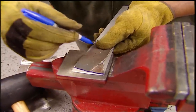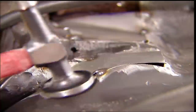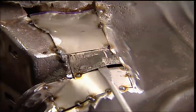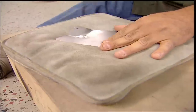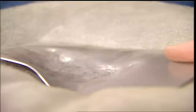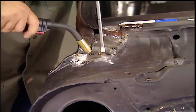Using the junk as a template will speed things up a little bit, but there's still a lot of tweaking and hammering to get it right. Two pieces in, about six to go. By now you got the point — use whatever you got to mimic the bends. This old shot bag will help out on this one; an old fruitcake will do the same. Time for this spot: three hours — that's how long it took Gilligan to wreck the Minnow.